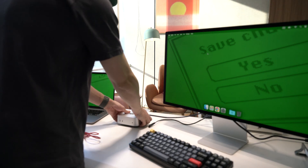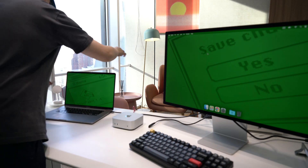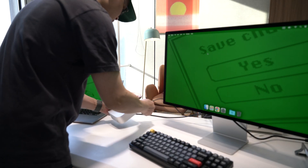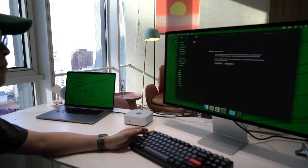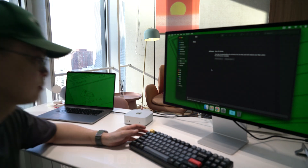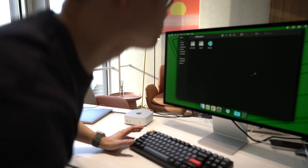There's one more step after installing the new SSD — you need to revive your Mac Mini M4 with the new drive. Since the SSD is empty, the Mac Mini won't boot. To do this, you need another Mac; anything made after 2015 should work, whether it's a laptop or another Mac Mini. Connect the second Mac to the Mac Mini via the DFU port — that's one of the Type-C ports — using a Type-C cable. Then, while holding the power button, plug in the power cord to trigger DFU mode. Once in DFU mode, you'll see an orange light flashing on the front of your Mac Mini. The other Mac will show a Finder window with the option to revive or restore the Mac Mini. Since the SSD doesn't have an OS, just click restore now, and the system will download the latest macOS and install it. The process takes about 15 to 20 minutes depending on your internet speed. Once done, a prompt will let you know it's finished and you can safely disconnect the cable. That's it — you have a bootable Mac Mini with the new SSD.